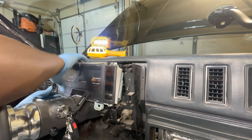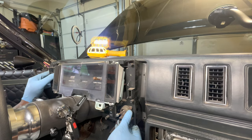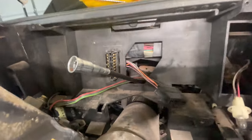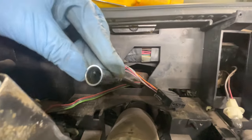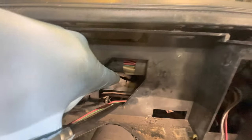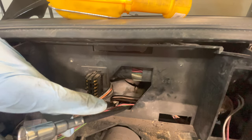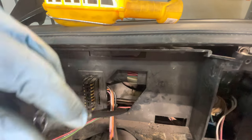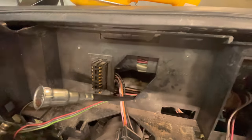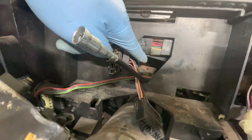I'm going to lift the entire assembly up and try to get that lined up. Let me show you what I did wrong with the speedometer routing. As you can see, this cable is routed underneath this bracket and it needs to be routed on top of it. It's placing a lot of strain on the connection at the back of the speedometer — whereas if it was up here it would have a lot more room. So I'm going to push it out and try to guide it to come up here.